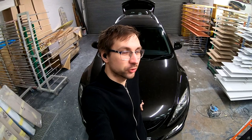Well, misfires, like the car is not running well on gas, that means there is something wrong. Basically, those exhaust fumes that should go back into the intake and into the combustion chamber are going somewhere else or being blocked completely off. That's not good for the engine itself. So that's why you need to do the EGR valve. But I'm going to clean it, I'm not going to change it.